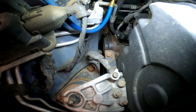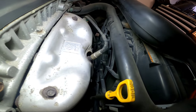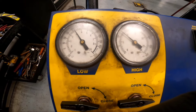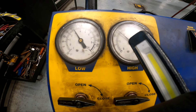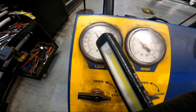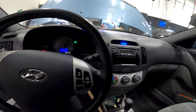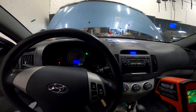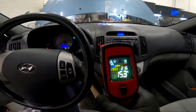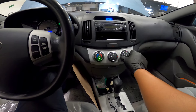The compressor is working and turning on, the cooling fan is on. Pressure reading: high side is around 125 PSI and low side is around 42 to 44 PSI. I'm going to turn off the car. The inner vent temperature is now reading 14 degrees - that's cold enough.